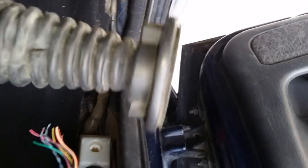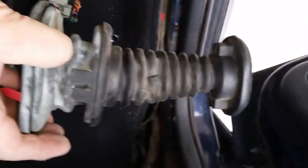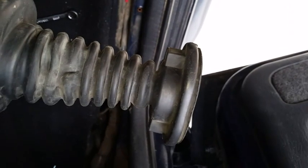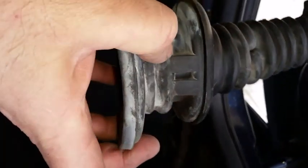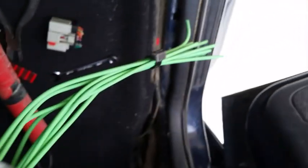Connect, the wires start going in through the small end and they protrude out of the big end. That's where the connector goes on this end. So forget that thing I just said a second ago. The wires go in the small end first, with the connector butting up against that small end of this boot, and the wires protruding out of the large end, just themselves. Okay, that's how it goes. One in the small end, all the wires are sticking out of the larger end.